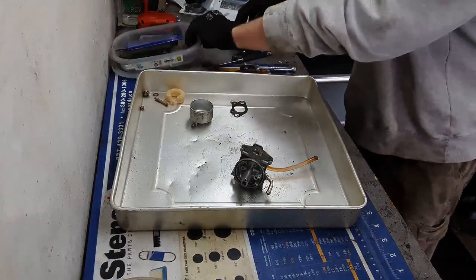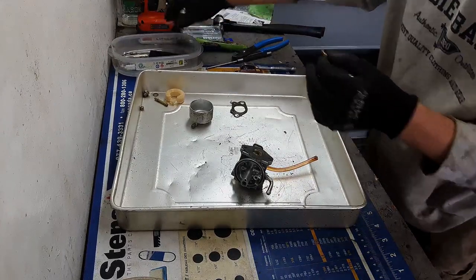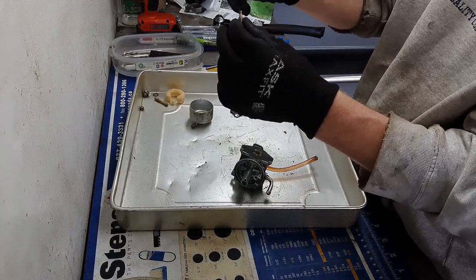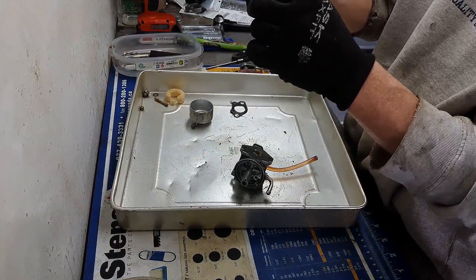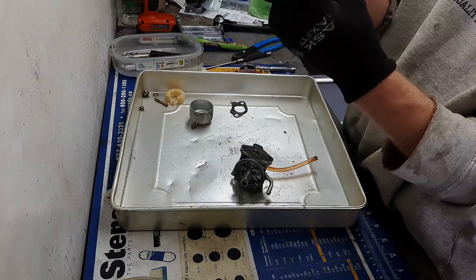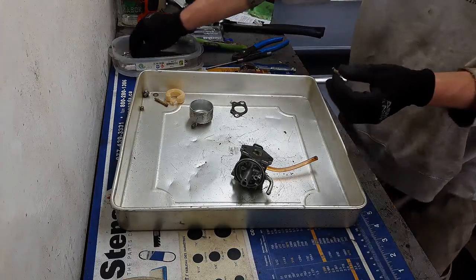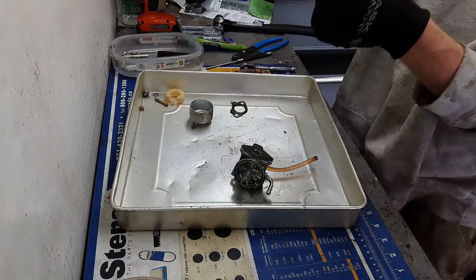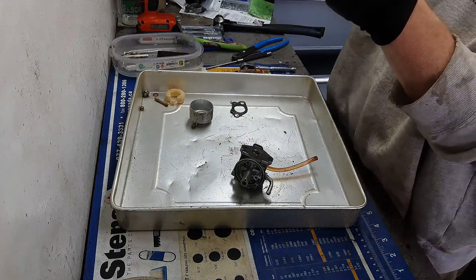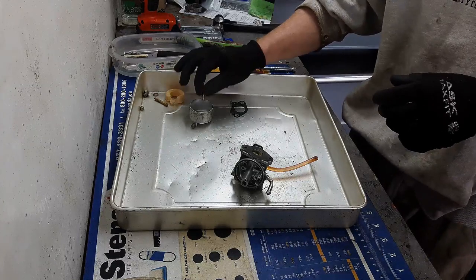My carburetor goodies, and I just have a little piece of wire brush inside the end of a matchstick, and that goes in nice and easy, so it wasn't really clogged. There might be a little bit of debris in there, but it's pushed through now if that's the case. These holes on the side are much bigger. And I wouldn't think that they would clog up there. And I don't see any clogs. This is all going in my ultrasonic cleaner anyways.